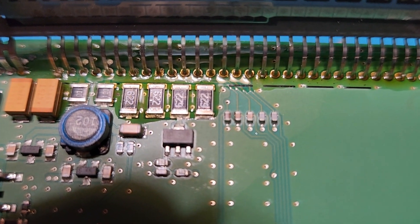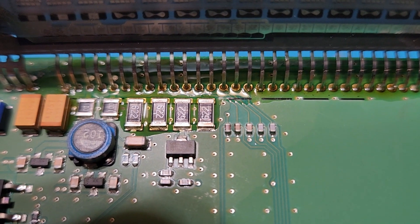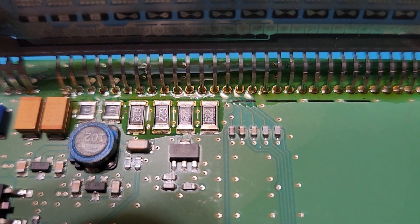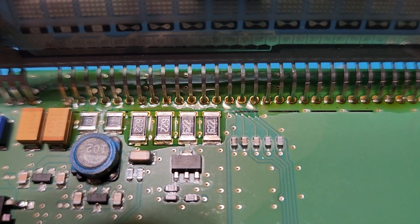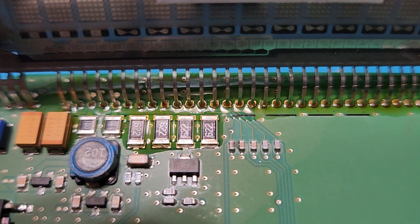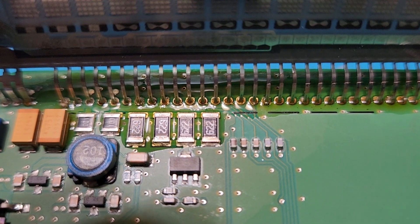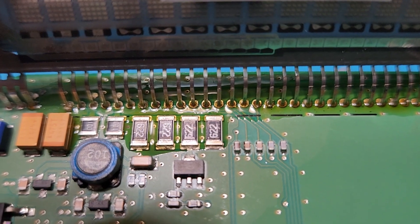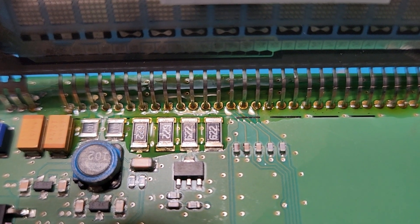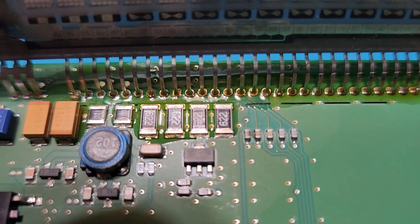What we're looking at right there are some resistors marked 622. There are multiple cracks in the solder joints for them. I first saw it by looking through the other side of the bars you can see in the upper frame, and I used a magnifying glass and a flashlight and could actually see the weak solder and a couple of cracks. So I went ahead and lifted the display board up to get access to them to re-solder them.